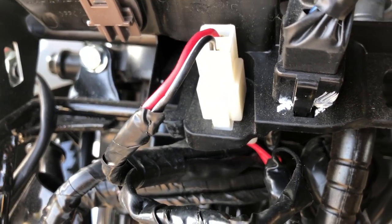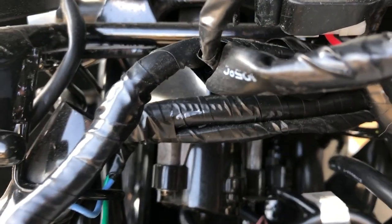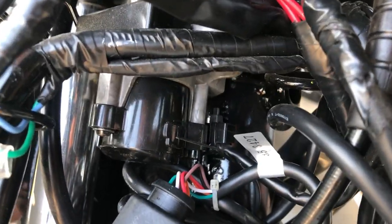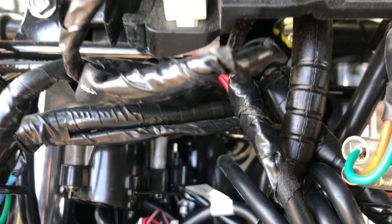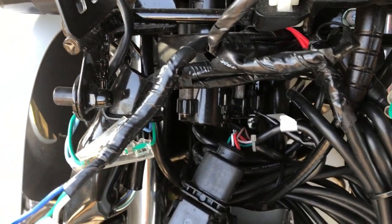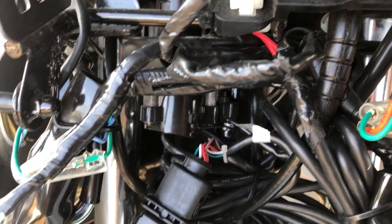You can wire it off the black and white wire, but I went off the other side of the plug. It was a thicker wire — the one coming off the ignition switch. It is a black and red wire, the thick one. When you turn the key on, you're going to get 12 volts, so that's the one I hooked it to.